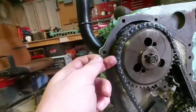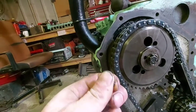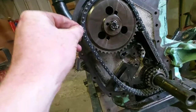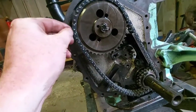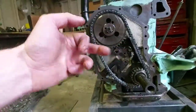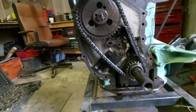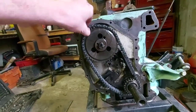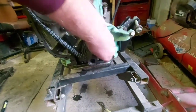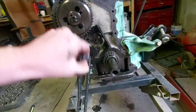You can see why it's important to be careful where you're putting your silicone. What I assume has happened is when the timing case has been put on, it's been sealed round the back of the timing case, and as it's gone on it's just touched the cam chain. But that's all loose now. It's tricky with one hand — let's have that off. Right, that's that off. Now your cam's free to spin, free to turn around and free to come out.